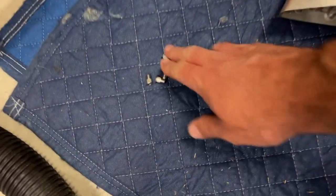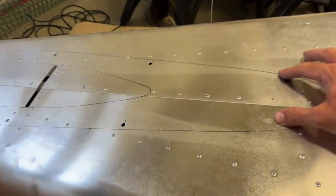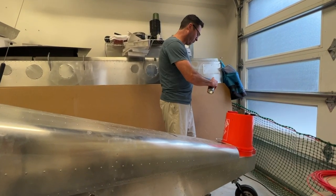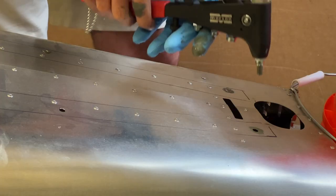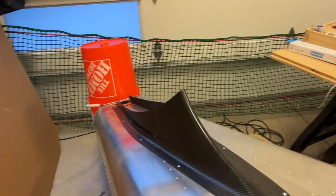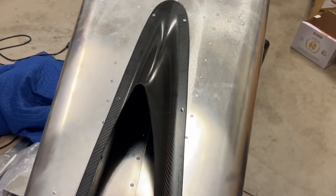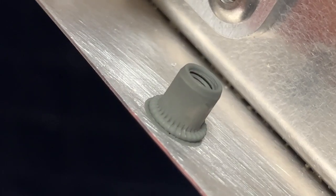Got the holes on the vert stab ready to go — I'm going to wet rivet those rivet nuts with primer to protect the aluminum from the stainless steel. Done. I'm going to leave the vert stab off because you need to put the horizontal on first before putting the vert stab on permanently. But that was pretty straightforward — just took my time with the drilling since I couldn't get back pressure with a wooden block, so super light pressure stepping up slowly with the drill bits.